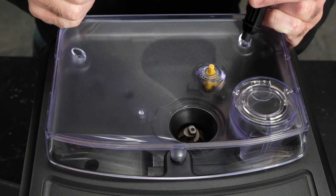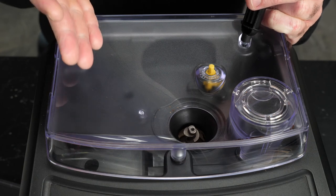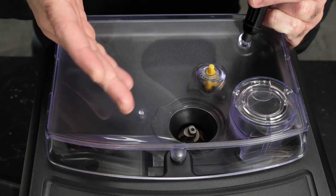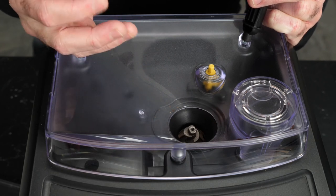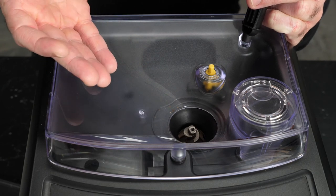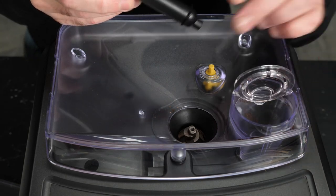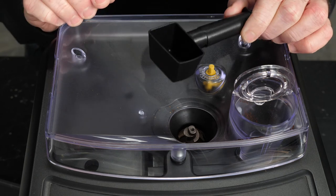And so that is my warning to you too, to avoid using oily coffees or beans. They can gum up this whole hopper, this mechanism, the brew unit. You really want something that doesn't have a lot of surface sheen or oils. Now, while we're up here too, we can take a look at the bypass doser. So that's where you use the other half of this scoop.